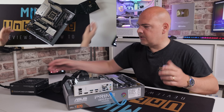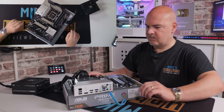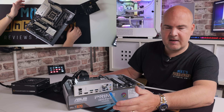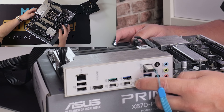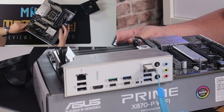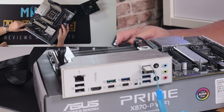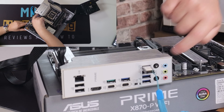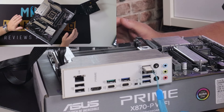What we want to do now is turn on the power supply. The next thing is to press the BIOS flashback button — press and hold for about two or three seconds, just hold it until the BIOS LED starts flashing. So one, two, three... and there you can just about see — the lighting is not particularly great here, but you can just about see that the BIOS LED is flashing. If you look through the side of the motherboard you can see it's actually reflecting on the back. What we're waiting for now is for the USB LED to completely go out — that means the BIOS flash is done.